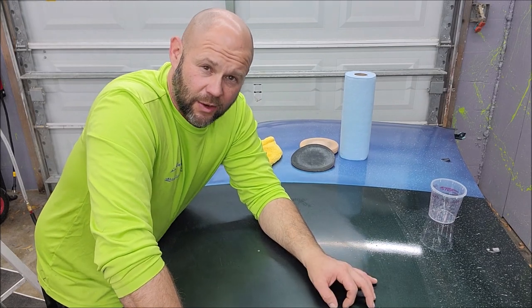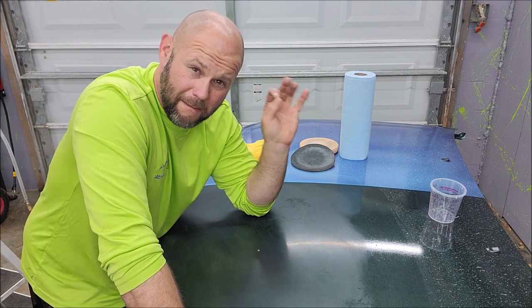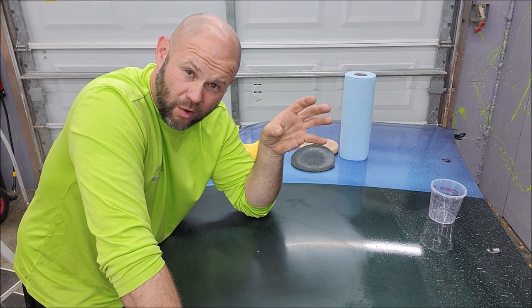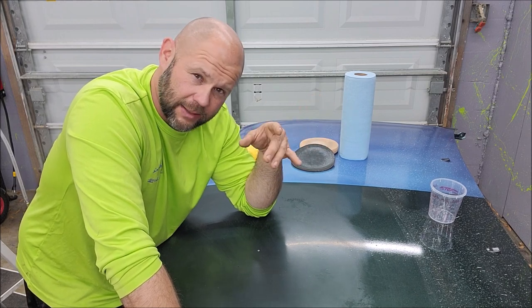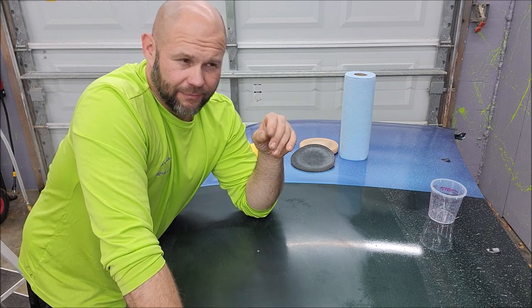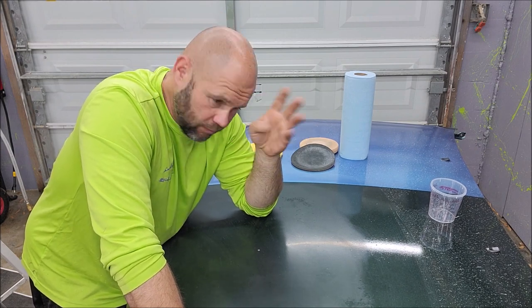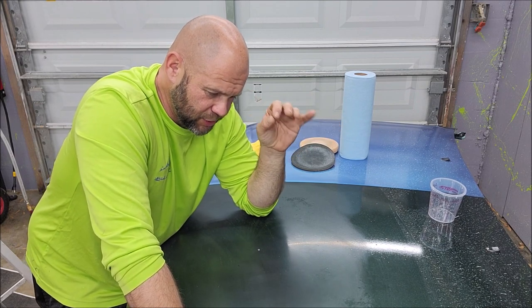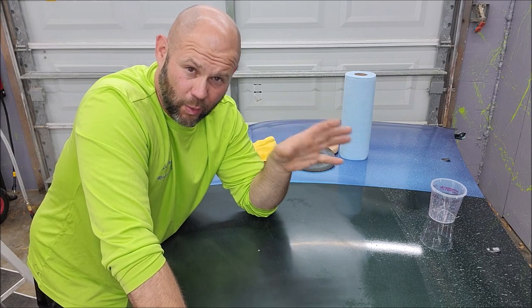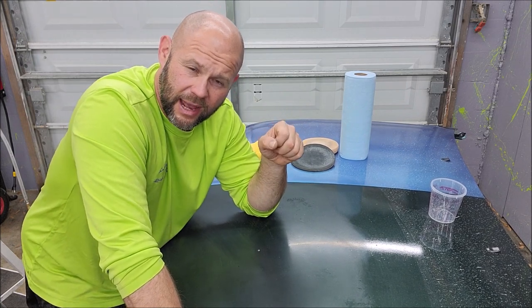I'm actually doing some testing right now with an electric spray gun. In fact, there's the Graco Ultra and the Ultra Max handheld cordless. Takes the DeWalt batteries. It's kind of pricey, so I ordered a really cheap electric one that's very similar in specs. And we're gonna see if this works. Actually I know it does, because a couple of years ago when we were testing, when I thought we had it almost done, and we didn't, and I had to work on it for another whole year, and so here we are. It's way better than it was last year. But when I was doing my testing, the gun broke, so I couldn't do a ton of testing, but it sprayed really well with the electric spray gun and the, I wanna say 1.2 tip that I had put in there.